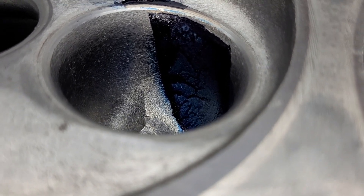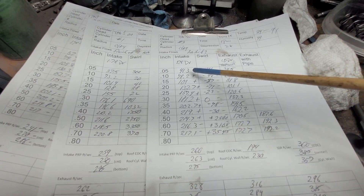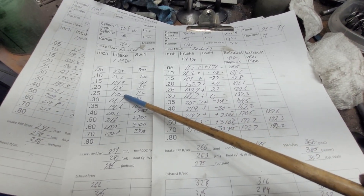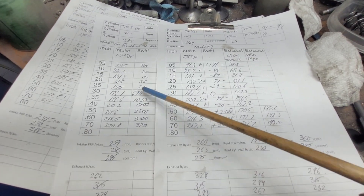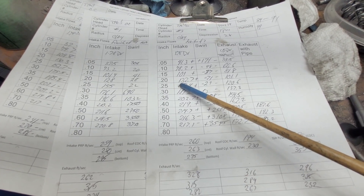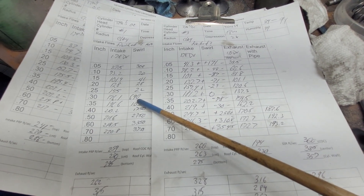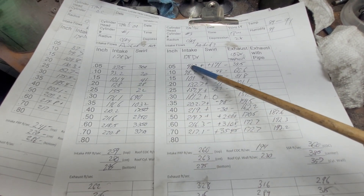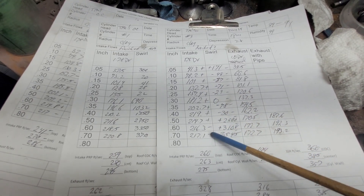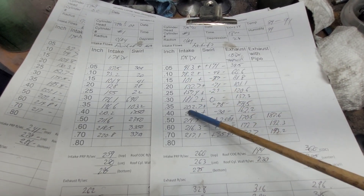Let's take a look at the flow sheet. These pluses and minuses are in reference to this one — cylinder number one. This is number three. Number three has got more bias towards the center of the cylinder; number one has got more bias to the outside. Looking at the flows: plus, plus, plus, plus, plus, plus, plus — except when we get to the very top where we lose a little bit. Overall this is a better curve.